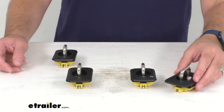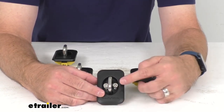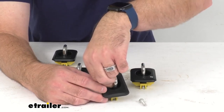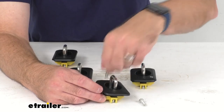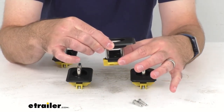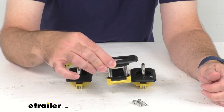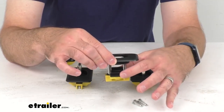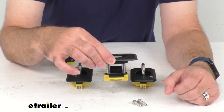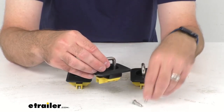After you've removed that plastic cap and done any necessary trimming, use your Phillips head screwdriver to loosen the two screws in the anchor and then remove those screws. That is going to allow the steel plate at the bottom to drop down freely. Once that is dropped down, pull up on the cover and guide that anchor into the stake pocket — you'll probably have to do that at an angle. Catch the lower bracket on the truck sheet metal, hold on to the ring, allow the cover to drop into place, then replace and tighten those screws.